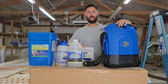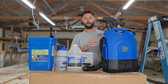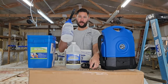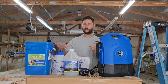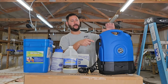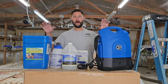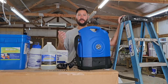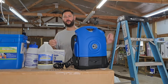I'm using the turbo tank because I don't want to have to bring a water hose inside the house. I'm using this portable sprayer with a commercial spray gun, and I've got an adapter that attaches between that spray gun and my coil gun. So I can go from spraying the chemical cleaner, then quickly detach the coil gun and spray it off — rinse it off with the commercial spray gun and the turbo tank 2.0. All this New Calgon offers; link in the description if you want to buy it or learn more. And of course, how do we reach the ceiling cassette? We may need a ladder — I've got a six-foot ladder to reach that four-way ceiling cassette.